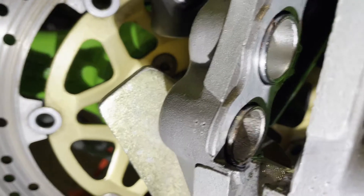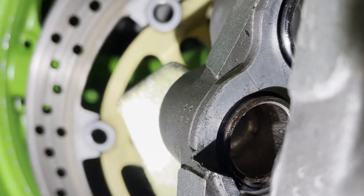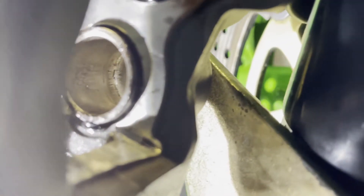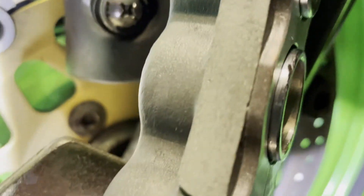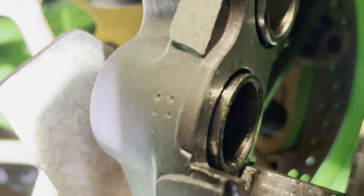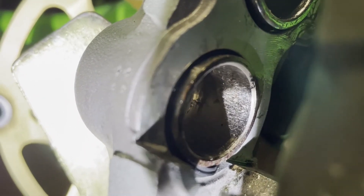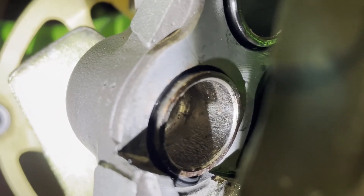I think I found the issue. It seems to be that very bottom piston there - you can just about see underneath a little bit of the rubber seal that's scrolled out there. You can see better there I think - you can definitely see it at the bottom. There's no fluid anywhere else anyway, so I'm pretty sure that's it. So that's a bad do. Another strip down and pull that out to sort it out.